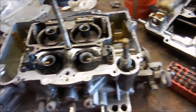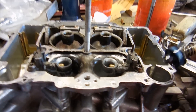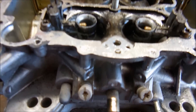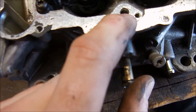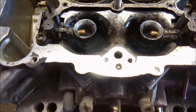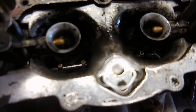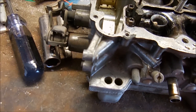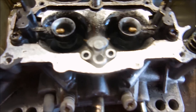I got the top of the carburetor off. The float bowls are full of garbage, but I did find out that the accelerator pump is actually still good — it might be old but it still pumps. When I pull the carburetor apart, if you look down in this hole, you see that little gold part? That looks like some kind of valve and it was stuck all the way to the top. So whenever I'd push on the accelerator pump, no gas would come out. I filled it full with B12. Hopefully with that back where it's supposed to be, I can put these little squirters back on and it should squirt like it's supposed to.